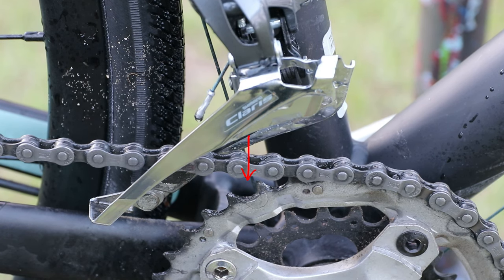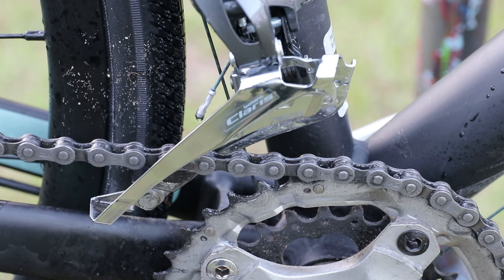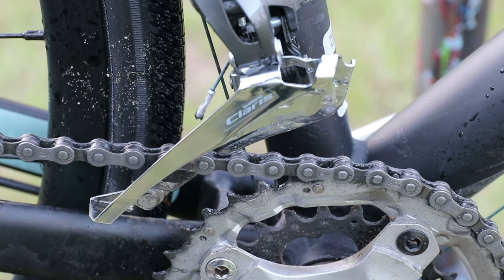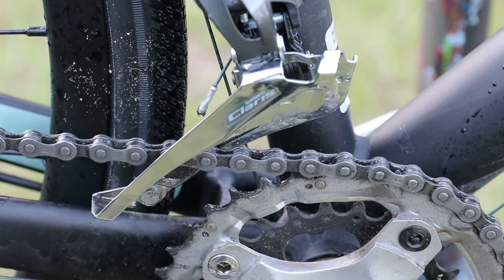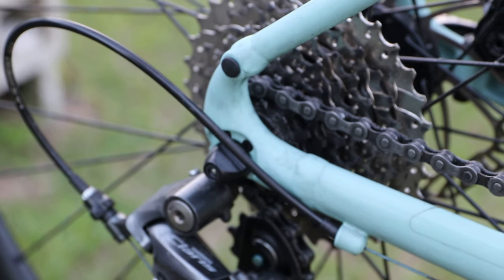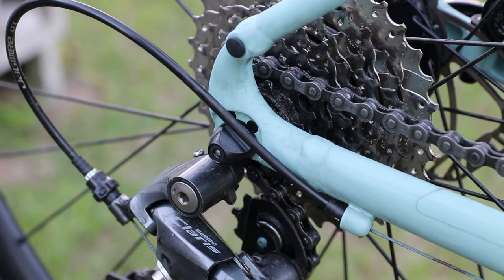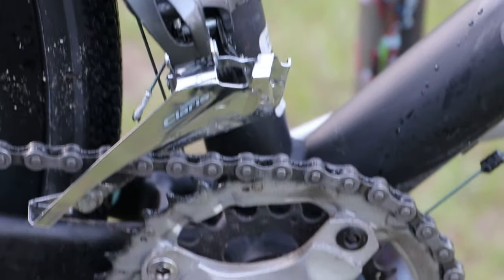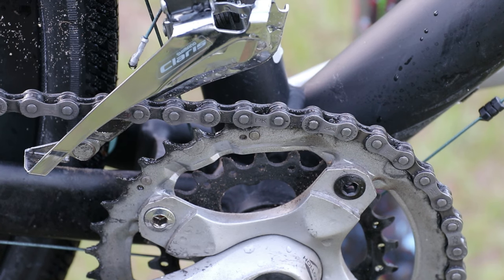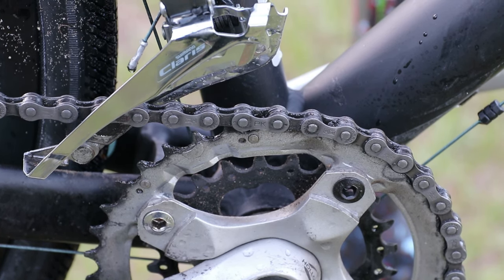Did it work? Did it cause any problems? It did. It wasn't massive and it wasn't all the time, but I probably had the chain drop in the weeks that I was riding dozens of rides, maybe five times. So it wasn't good. It's not a ton of droppage, but it's enough where it's not fun. And it's especially bad because it's when you're on your smallest cog in the back. So you're trying to go as fast as you can, or you're sprinting. When I was pushing the power down on the pedals in the biggest gear, suddenly it would fall off. That's a very unnerving feeling - really makes you hesitant to put too much power into it. So it's not good. It didn't work kind of as I expected.